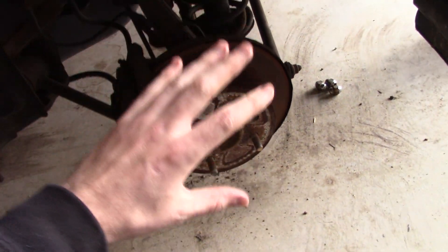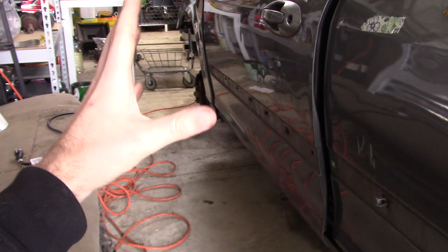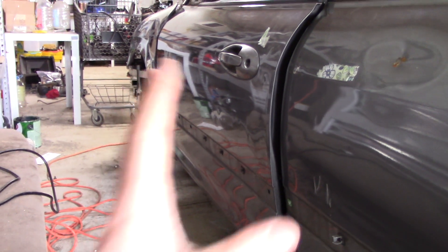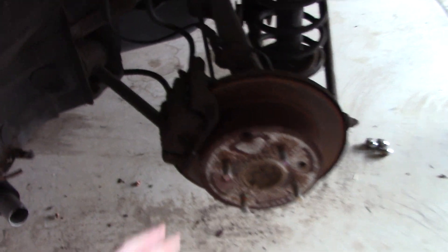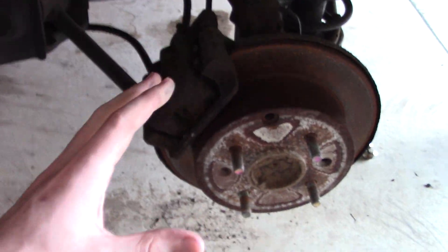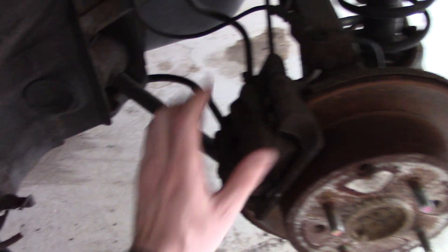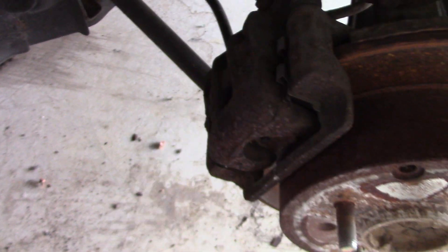Before somebody says — I don't think all rims will fit every car because a lot of them have a different offset and they'll hit the brakes — this is why you have to be careful on the front of front-wheel drive cars. If you exchange a 16-inch rim down to a 15, a lot of times you hit that brake caliper. Well, that's the beauty of these front-wheel drive demolition derby cars: you don't need back brakes. Almost all of mine, I remove the back brakes because they either leak or they're going to leak once the back of this car pushes in. I haven't done it yet on this one — we're going to remove this entire brake caliper, cut the line off. This car already had bad brakes, there was no back brake line at all, it was rotten out in the middle and leaking, so we've already patched it all off. Once this caliper is off, it doesn't matter — you can take a rim and put it right on here and it's not going to rub on that brake caliper.